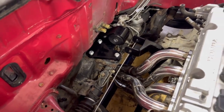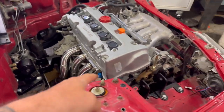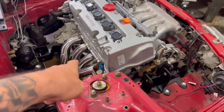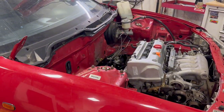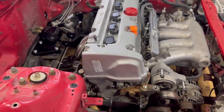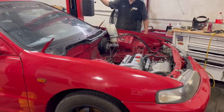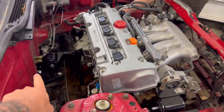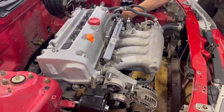I just realized we don't have the intermediate shaft for the CV axle — we only have the outer shaft, so we need the intermediate as well. The engine looks good in there but it has to go a few inches back to line up. As we've learned, we're also going to need a different header — one that goes straight down and back, not just angled. And we've got the harness to put on.